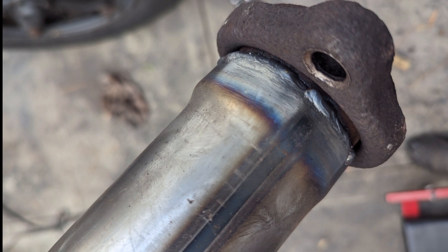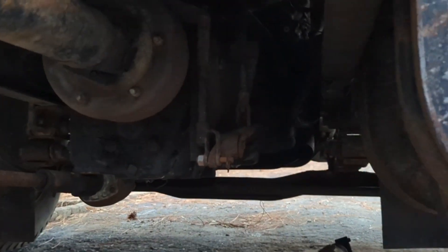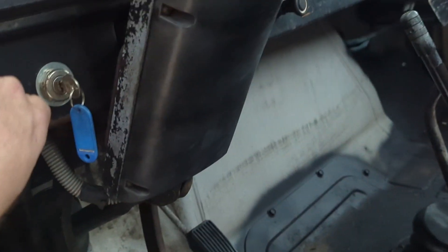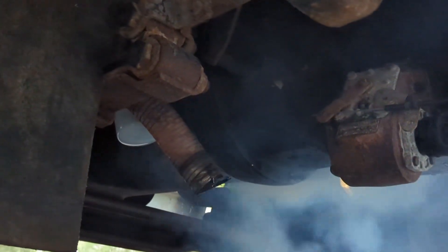Started the exhaust. I was able to use my original downpipes from the manifold and welded on some fittings. Big old muffler that I yanked out of there probably weighed about 100 pounds. I still got the smoking issue here — this is before I took the leaf packs out, so don't kill me on that. We're jumping around a little bit, and this is also before I had the Dynamat in. It still smokes like crazy when I first start it up, even after the new injectors. I still got to figure that out — it almost sounds like it's missing.